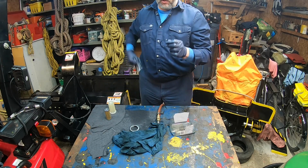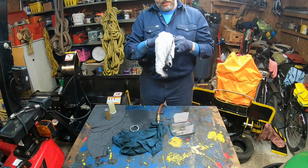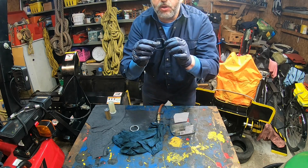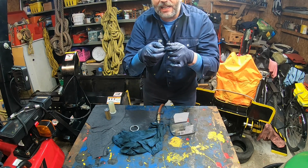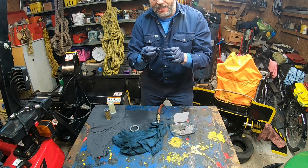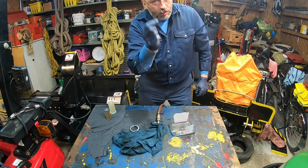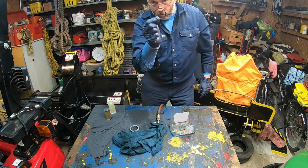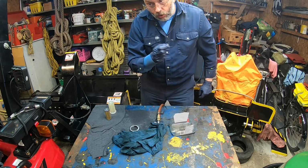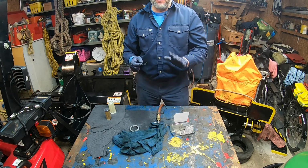This is the old O-ring. So what you do with the O-ring, basically, I clean it very well. When it's clean, then I do a good visual inspection with my glasses. I make sure there's no crack, there's no tear, wear. Everything is still flexible. And this is an O-ring which has been in for 4 years. I'm gonna put the new O-ring, but I'm not gonna throw that away. I'm gonna keep it as a backup because that O-ring is also the same O-ring for the first stage fuel strainer. Sorry about my English.